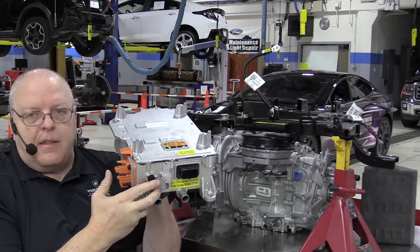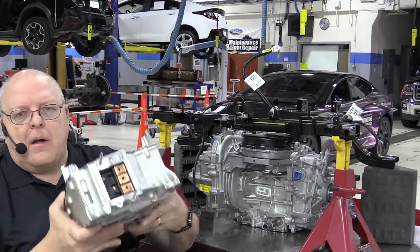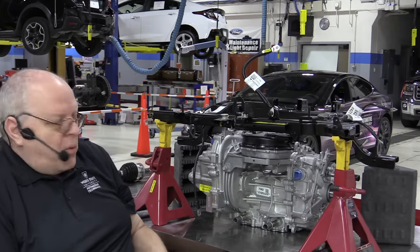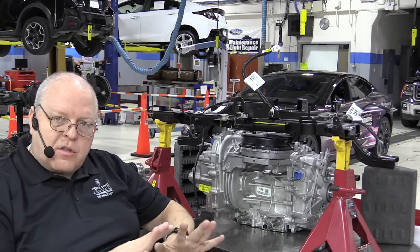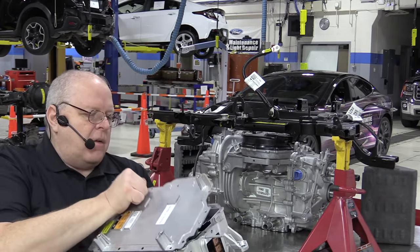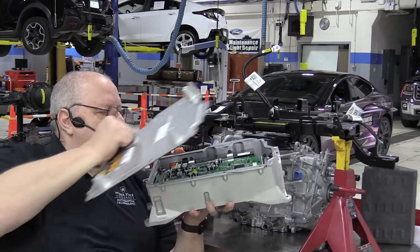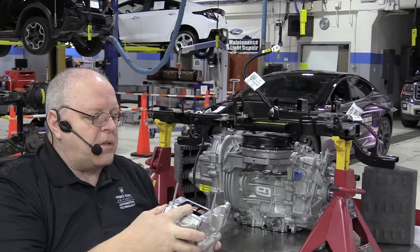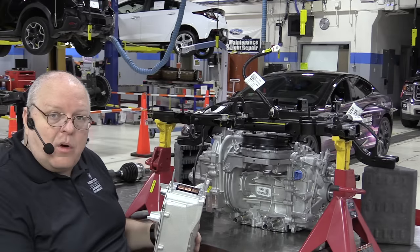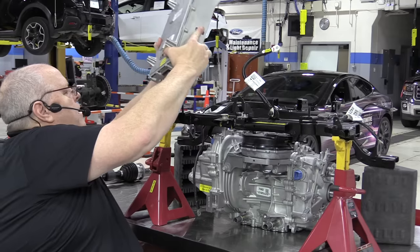The SPIM has two-wire DC coming in from the battery, and then in the back there is the three-phase electrical connection going out that will feed power to the three-phase electric motor in the drive unit. The particular inverter I have here I purchased off eBay — I've taken the lid off and will explore the inside in a different video. I'm pretty sure it does not have a boost converter inside to step up the voltage, but I don't know yet. This Single Power Inverter Module sits right up here on the under hood cross car beam.